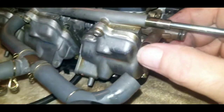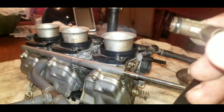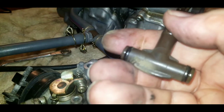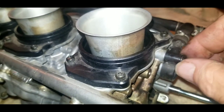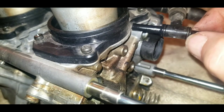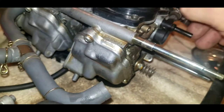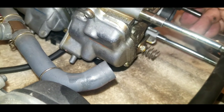The next thing is to pull out the T with the leaking o-ring. There we go — the o-ring on the right here is the one that was dripping. Hopefully I can go to the hardware store and get matching o-rings for this without having to wait and order them online. There are more o-rings up here on this upper line as well. Since I have this all apart I might as well replace these too — I'll take them all with me to the hardware store and see if we can match them up, then come back and show you how to put the carburetors back together.